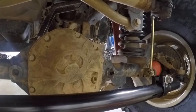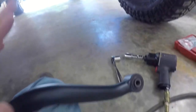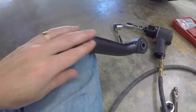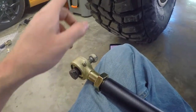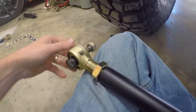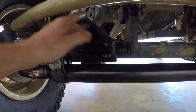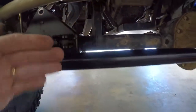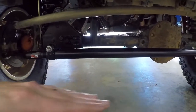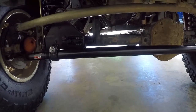The next step is to get this bolt out, take the other one off the frame side, pull this old bar off, and then place this new bar in the correct position and get it bolted up to the frame. For this end we're going to have to measure and set the centering of the axle. This is what centers the axle — when you bolt that onto this bracket on the axle, the link positions the axle left and right relative to the body of the Jeep.